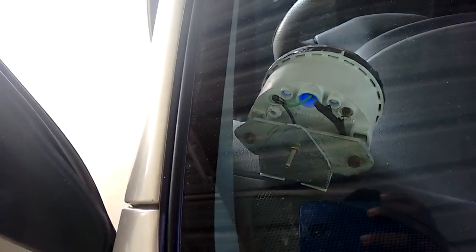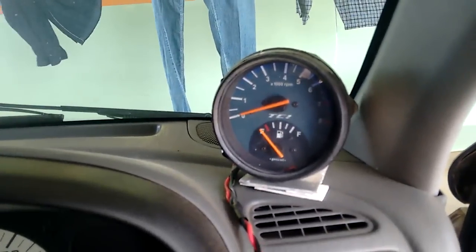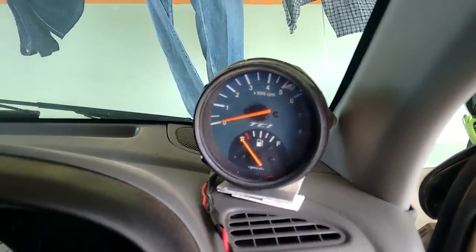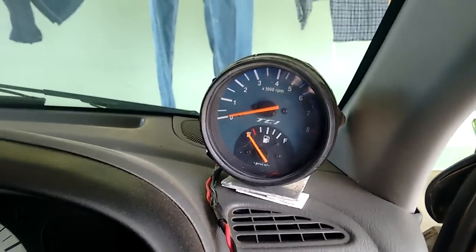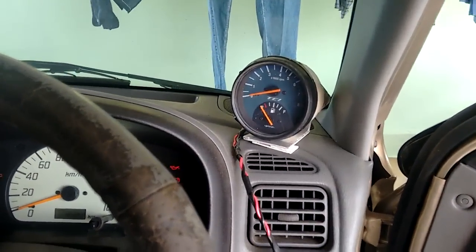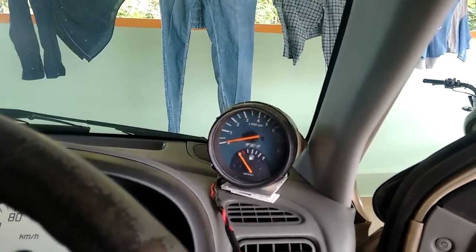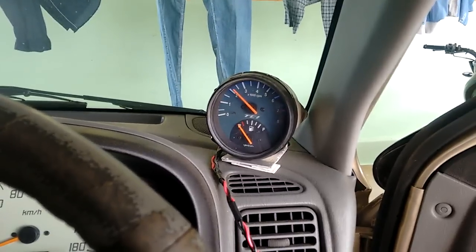I'm not exactly sure of the exact wires — I just figured it out by trial and error. You can usually pull the unit apart and see based on the labeling on the circuit board which wire goes where. I didn't exactly calibrate the tachometer, so the starting RPM showed around 2000 when it's actually around 500 to 600 for this vehicle. To calibrate the instrument you have to change the resistor values inside, and you can use the internet to find the exact circuit and how to calibrate it.